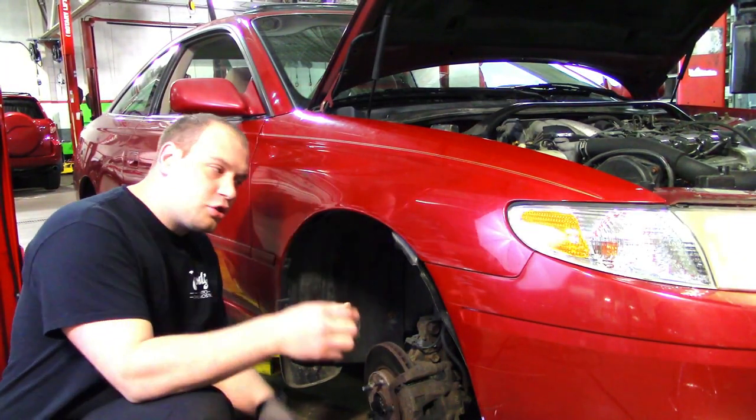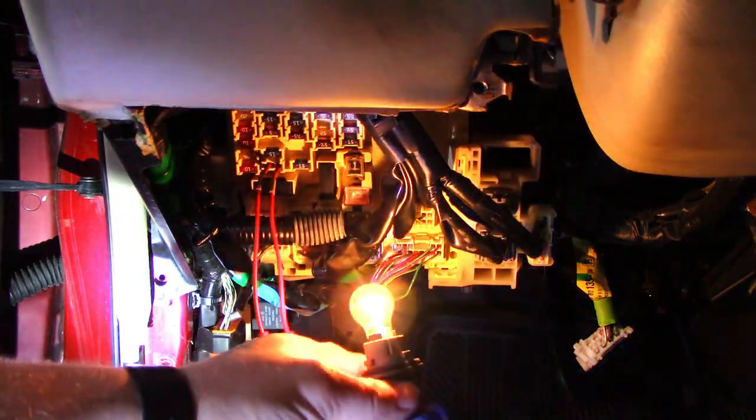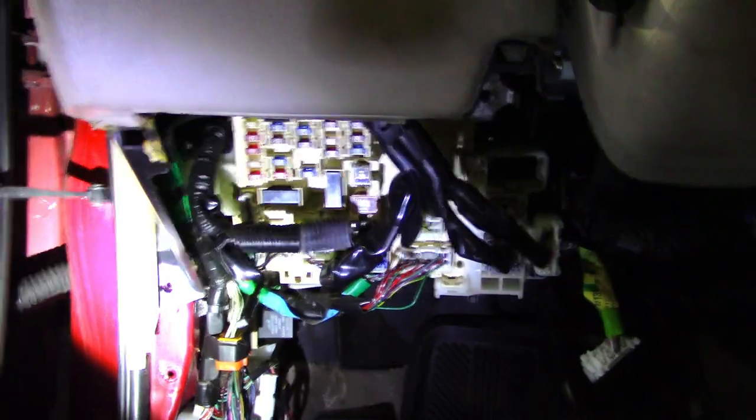I got a new bulb and socket and plugged it in. The bulb in the fuse box is clearly dimmer now — that's because we have resistance running through a series circuit with multiple resistors. I pulled the substitute light bulb out, put the fuse back in, and I didn't hear it pop. The tail light bulbs are lighting up — it's fixed! I hope you all learned a thing or two. That's how I attack a lot of simpler circuits. Not every circuit can be used this way, but this one was simple with not a lot of splits. Make sure you like and subscribe.